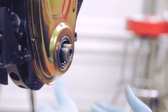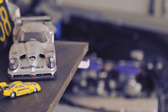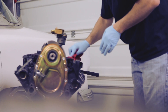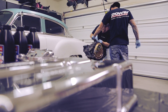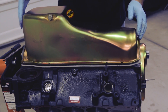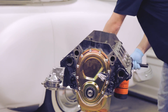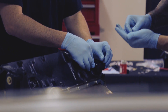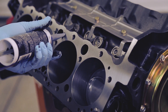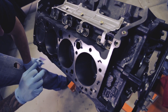We test the fit to make sure it's on there correctly. The gasket's down, the sealant's down. We're putting the pan on so we can seal up the bottom end, and then we can rotate it over and start getting the top end together. I'm going to lay a little bit of silicone around each water jacket, and Mike's going to come in after me and spread it around so that no water can seep into the gasket itself.